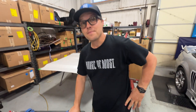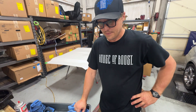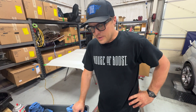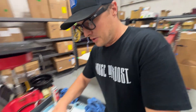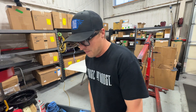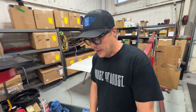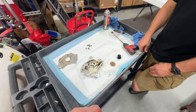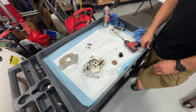We're dropping oil pump gears in here, but I've heard the internet talk about sometimes deburring things in there. Are there sometimes burrs inside the oil pump housing? Yeah, you go through and just look, run your fingers around — if there's anything that catches, then yeah, debur it. But out of every 10 of these I do, there's like one that needs cleaned up. If we find a burr, we'll show you what it looks like and how to clean it up.